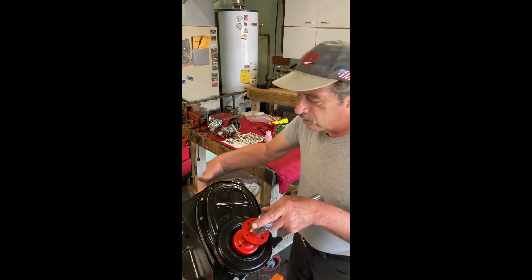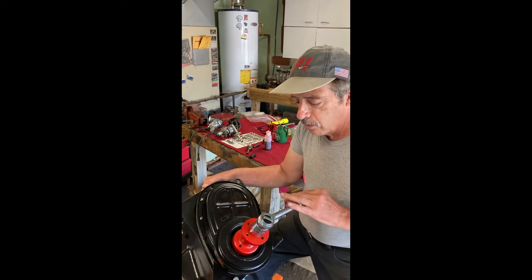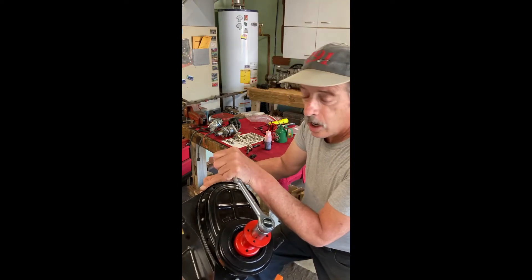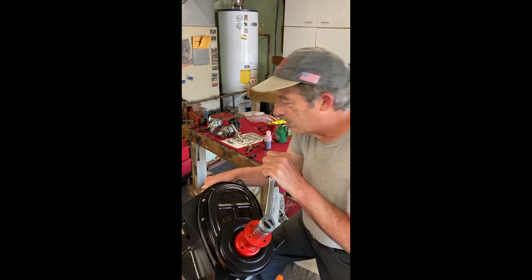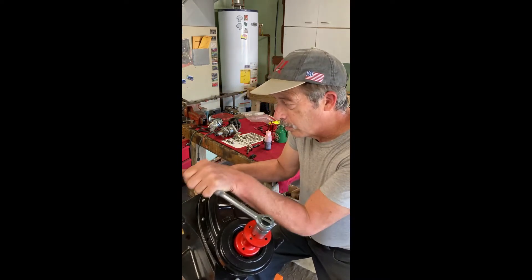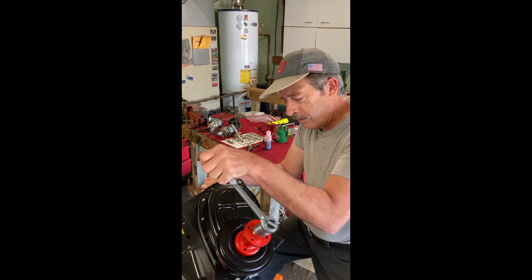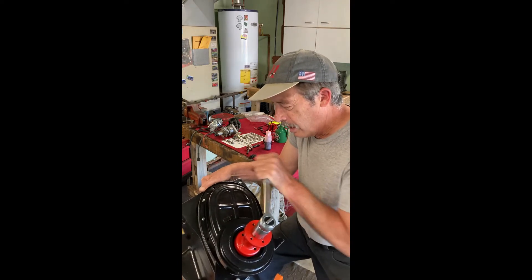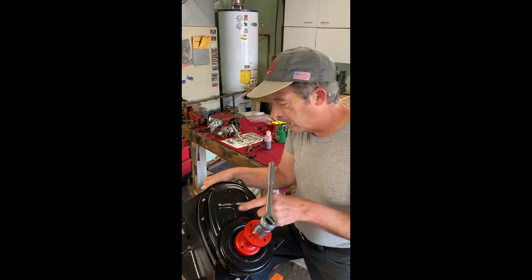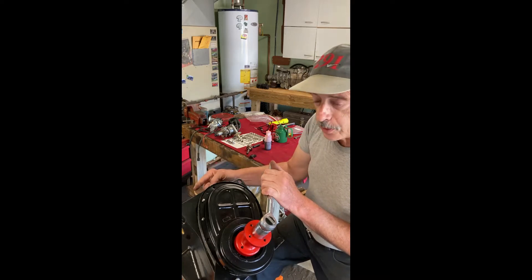Now I've got my fingers on the lifters. The piston is all the way up. If it's on the power stroke, the valves are not going to move. The valves are not moving. Now the exhaust valve is opening, which means the piston is coming up. Now the intake valve should open - there it goes. Intake valve is opening, sucking in the gas. Now the intake valve is closing, and we're going to come up to top dead center right about there. It lines up. So now we know number one piston is firing - this is when the spark is supposed to be there.